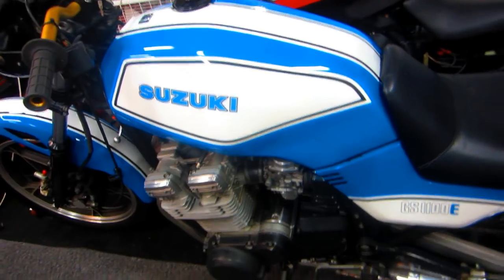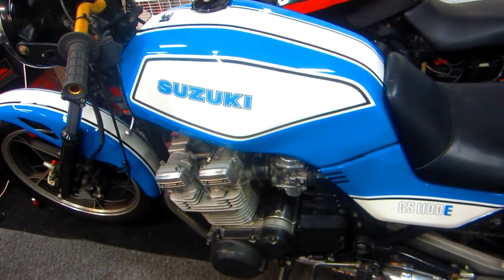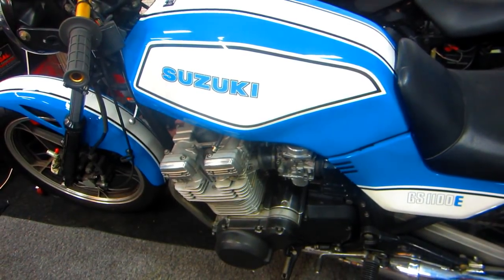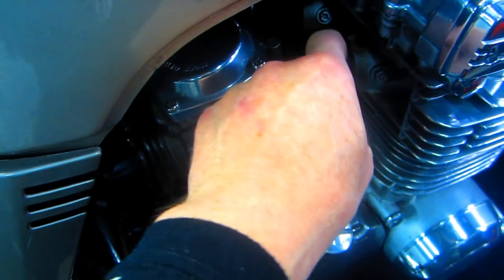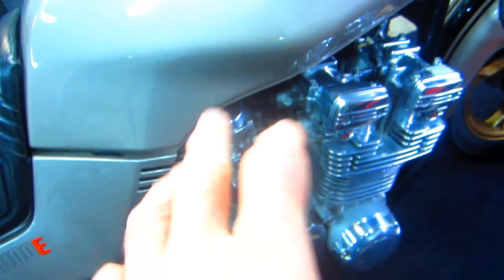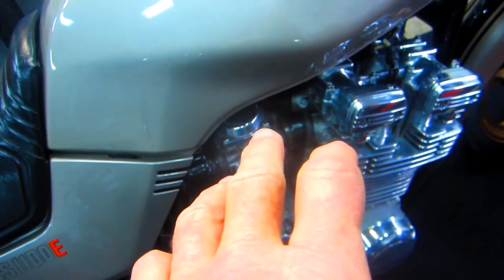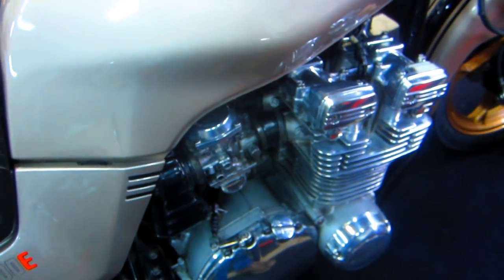These rubber connectors that connect the engine to the carburetors, they're 35 years old. And what happens, they dry out and they get these little cracks in them. And so that tool will allow us to diagnose if we have a vacuum leak. And actually, these are pretty hard. Sometimes, yeah, they're really hard. So the advantage of doing this is if you can do it on a warm day, or you can somehow hair dryer those and make them soft, that'll make it a lot easier.